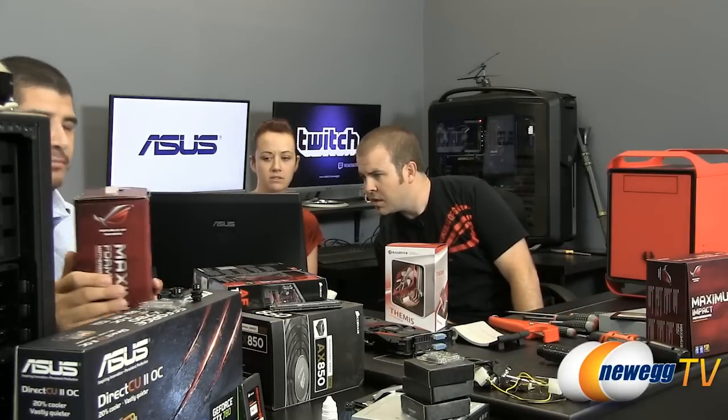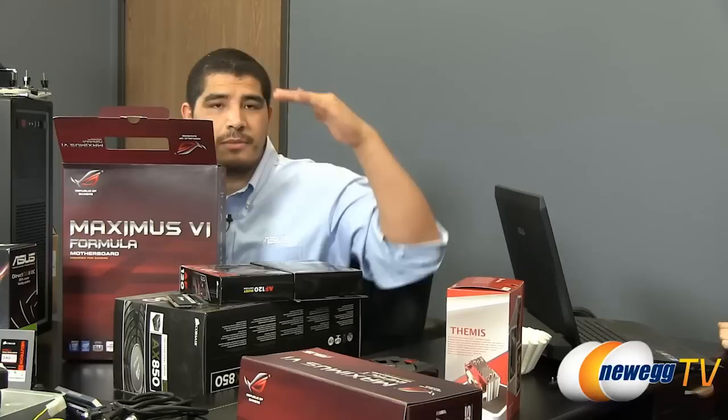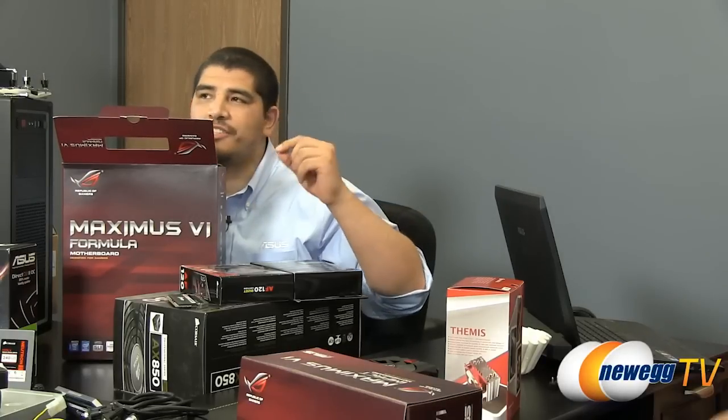Is that in this? CPU heatsink clearance for InWin's D-Frame. Wow, that's a good question. I've found that if you have anything larger than about like a Noctua NH-U12S, it will still fit, but you won't be able to put the tempered glass side panel onto it. So if you look up the dimensions on something like a Noctua U12S in terms of that height clearance, if you shaved off maybe about 2 centimeters, then you would be entirely fine, and you could put the tempered side glass on there. If you don't care about putting the side panel on there, then there are no clearance restrictions.